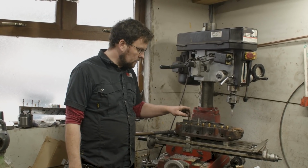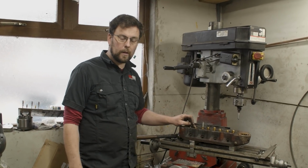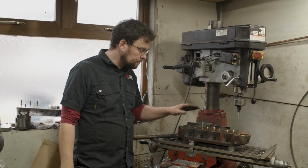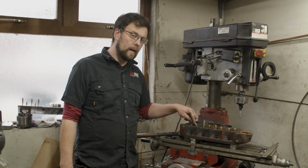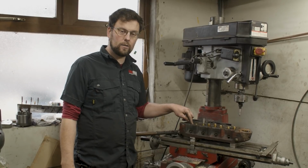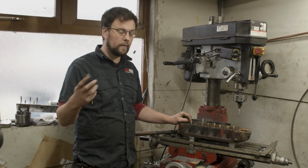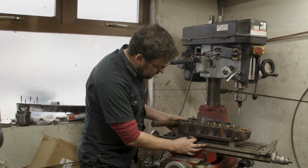Also remember that the valve spring seats have been cut, so dropping them down a little bit below the original height is no harm whatsoever. And thirdly, getting more engagement of the valve guide into the cylinder head is a good thing, because more heat can be taken out of the guide, which in turn takes more heat out of the valve and makes the whole operation more reliable. So drifting it in, nice simple process.